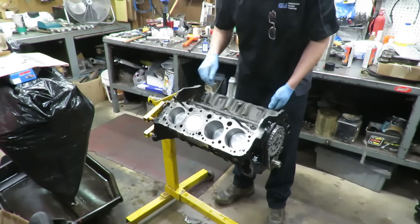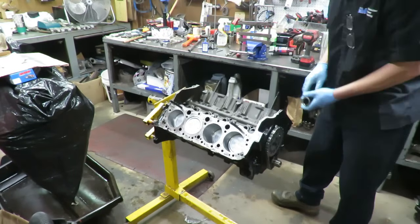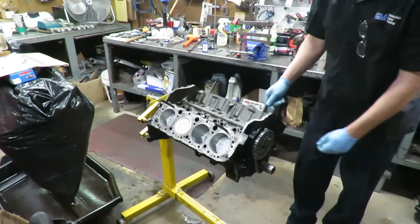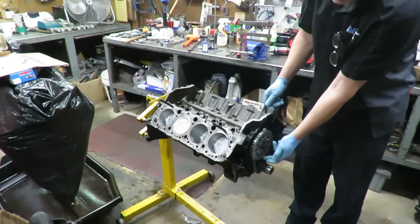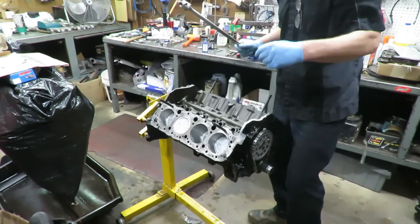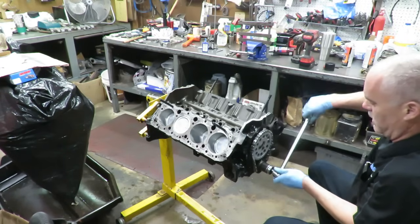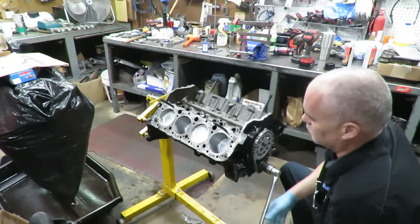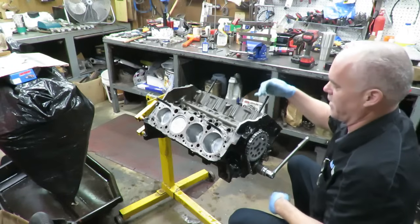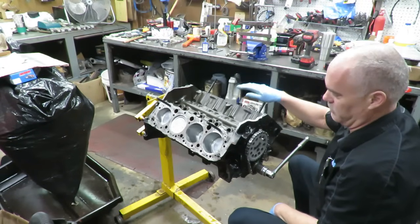Man, I'm not used to this little tiny dinky bore, but I mean, it is what it is. It's turned out really good. I put the new timing chain and gear set on, and of course make sure that they're dot to dot on this one. We're not going to degree the cam on this thing. We're just going to go dot to dot and call it good. So yeah, the short block turned out really good. Got everything torqued on the lower end. Turns over real nice. I just put these four studs in here because I just happened to have them laying around. These are ARP studs that were left over from, I don't even know what they were left over from, but